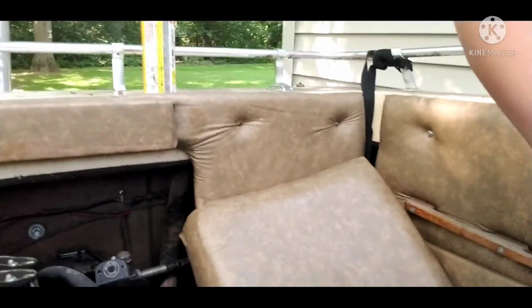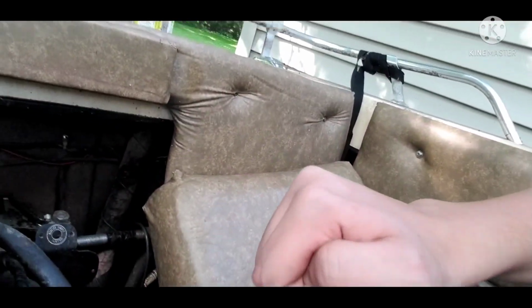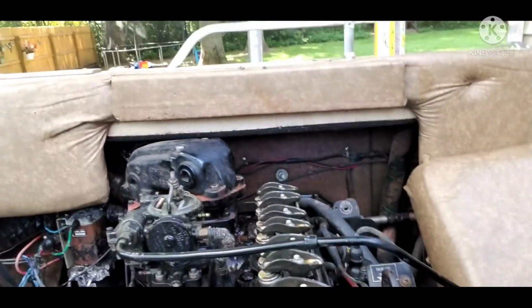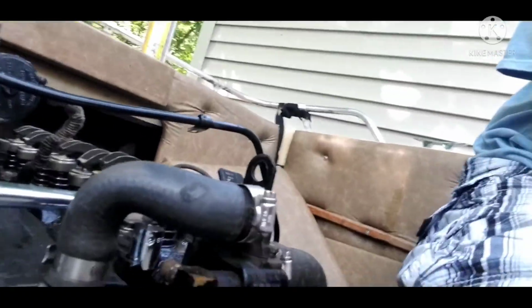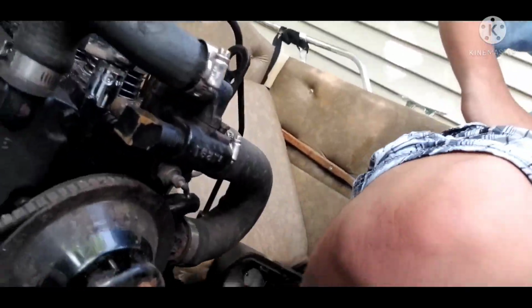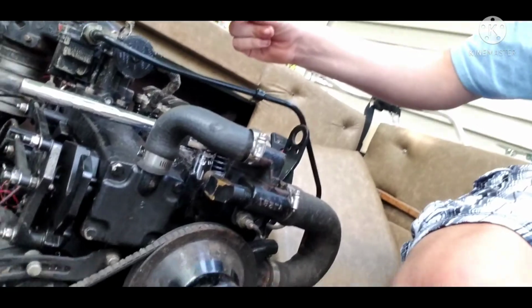There is a certain sequence to loosening the head bolts and also tightening them, which is like, I think 1, 2, 3, 4, 5, 6, 7, 8, 9, 10, something around there. I need to look at that again. But yeah, head bolts, they're coming into play, but first I gotta take off this manifold in order to successfully remove the head, and also the push rod cover's down there as well, so I gotta take off a few more things to replace that gasket and also replace the bolt seals and stuff. So I'll go ahead and take off the manifold right here so I can show y'all what's going on there.